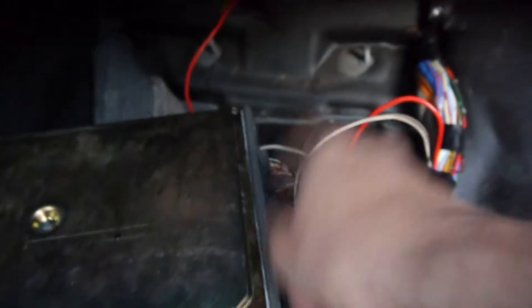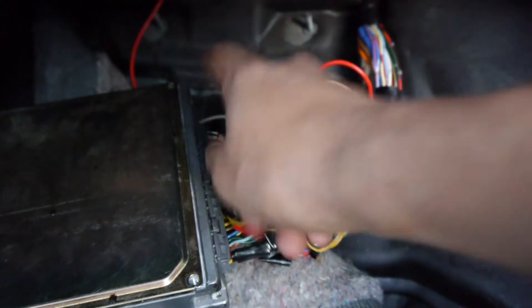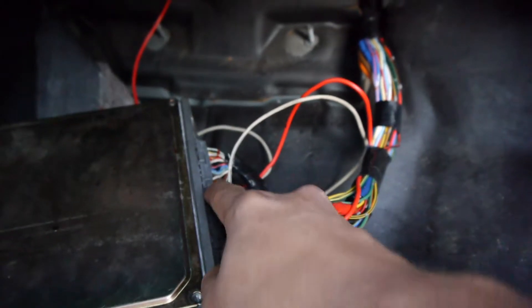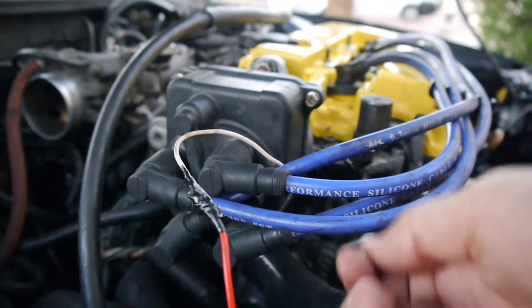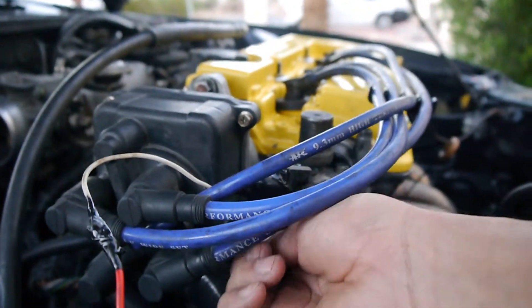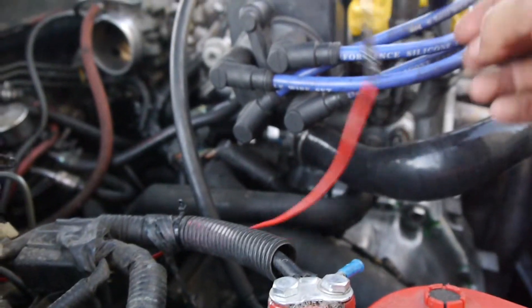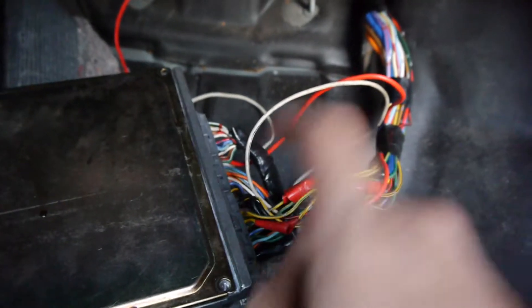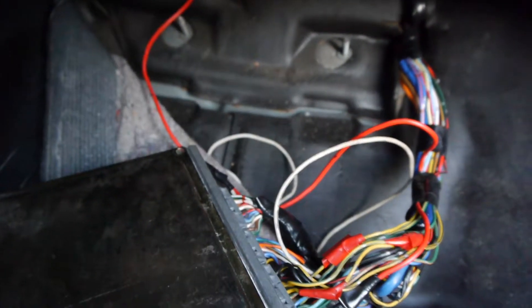For the pressure switch you go to D6. The connectors are A, B, and D — there's no C. So the last connector is D, and you go to D6. If you had the pressure switch, you hook up the connection to it and run the wires to the ECU, same as you did for the solenoid wire, all the way to D6.